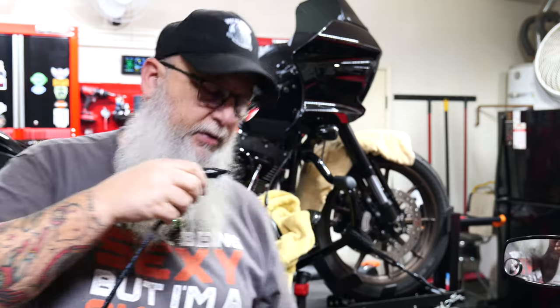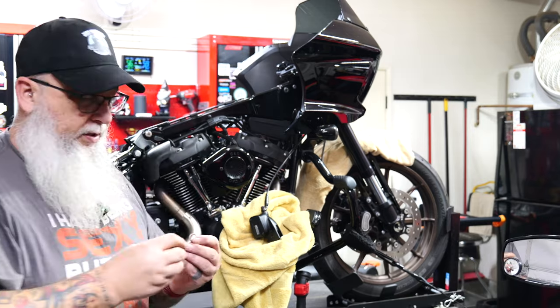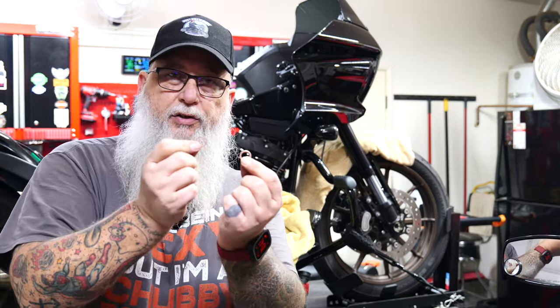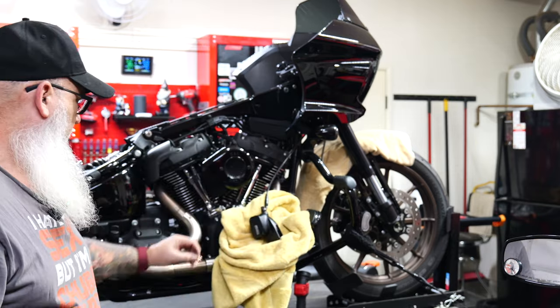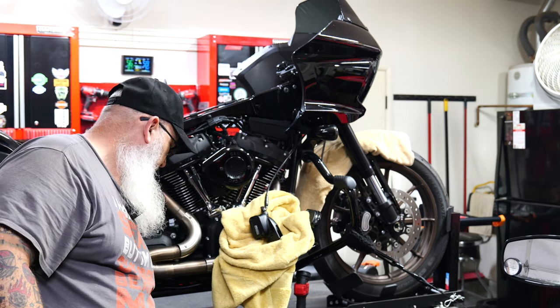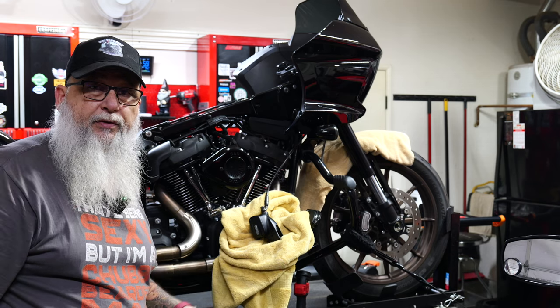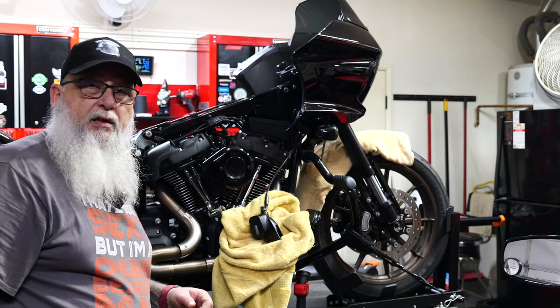The difference between the cables is obviously length, but also here's why you need the adapter — the new cable is straight where the other cable is a little angled from the stock. So we put that on the other side, get it all loosely in place so I can manipulate it when I mount it up on the bars. Won't do any fluid or anything yet — just going to get it mounted and ready to go. I'll tighten it all up once I get the bars where I want them. In the kit comes two new little brass washers, so put one on each side of the connector — you'll see them on the existing one, just put it back the way it was.